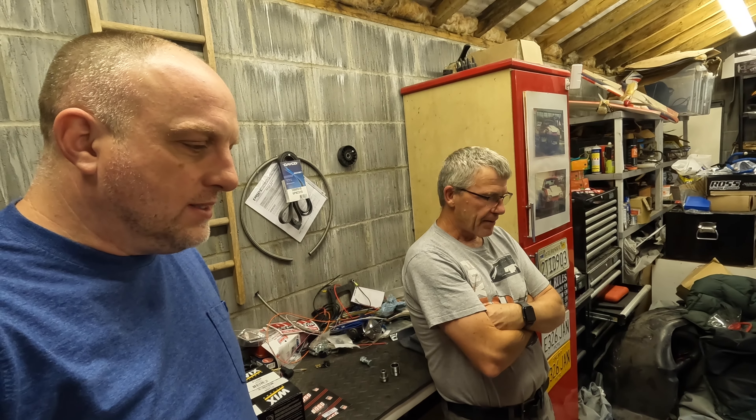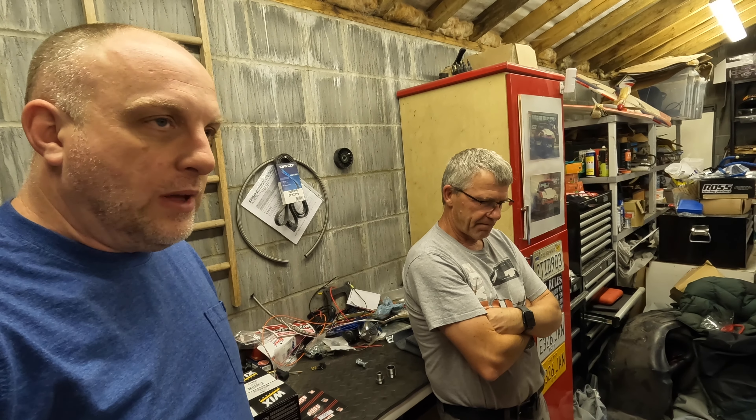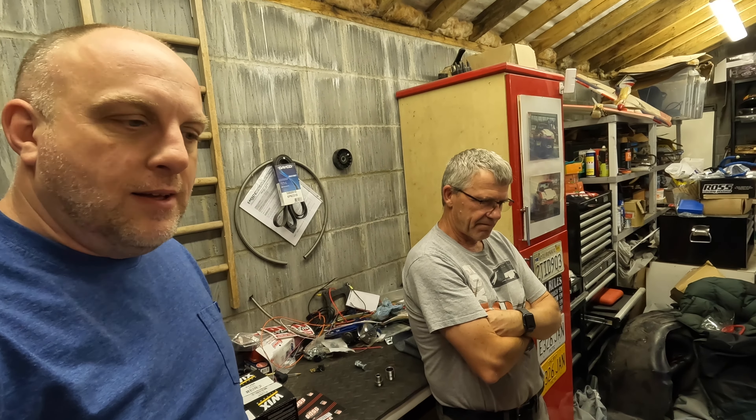Hello again, welcome back. Today we're going to get sciency. Pete has had some warm low oil pressure problems — not really a problem but it's a concern. When it gets hot, the low oil pressure light goes off below 20 PSI. It shows about 15 PSI at hot idle, and we're going to see if we can fix that a little bit.